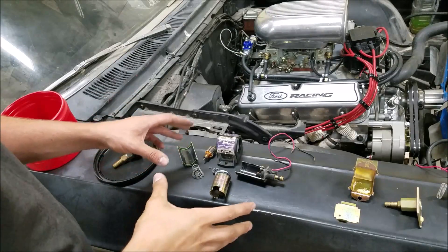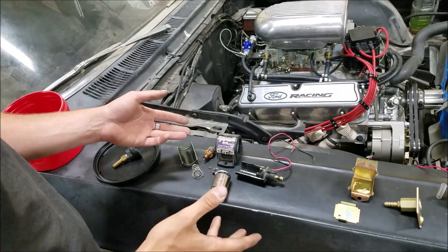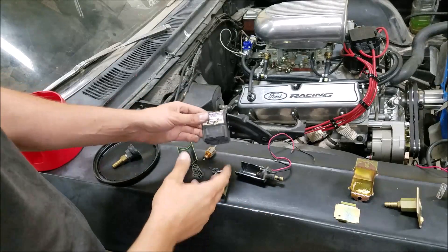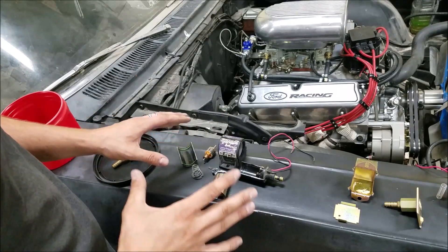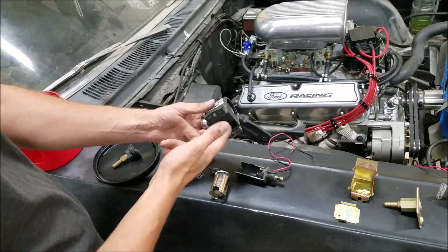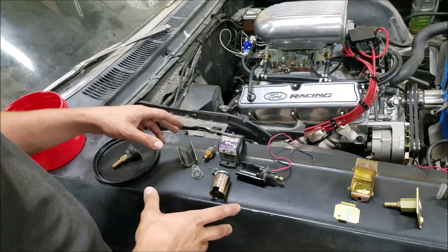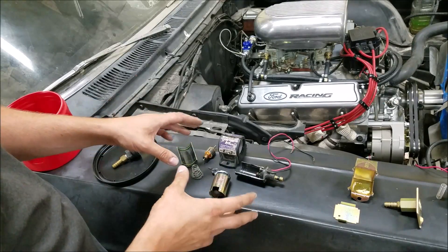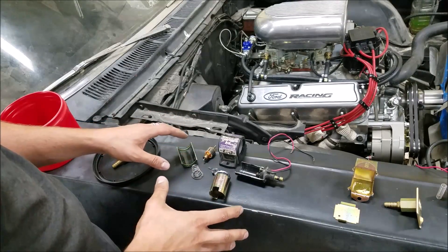Let's take a look at our other one. Now we're going to look at those other fuel pumps that you find in parts stores. They're usually a little bit more expensive, about 50 or 60 bucks. I think the ones they sell currently are Edelbrock, but this is a Mr. Gasket — they're all pretty much built entirely the same, probably come from the same place with just a different cover. These are a little bit better in form and function. You might be able to get away with running them longer, although their gallon per hour rate is still pretty low, so you are kind of limited to a deadhead system.